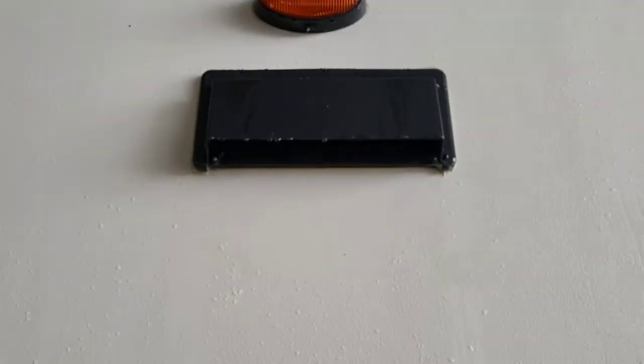You got your vent for your range. So your range vent. If you're going to have your fan on, make sure that these tabs are open. That way this flap can move to displace the air it's venting out. If not, if you have it locked closed, it's not really venting anything out. It's just running the fan in there.